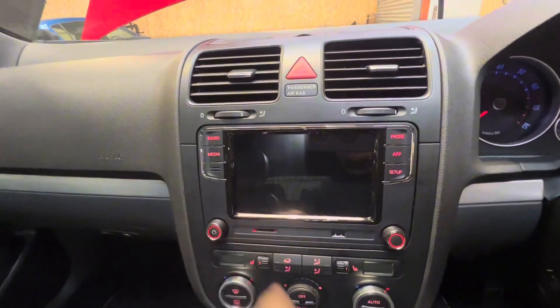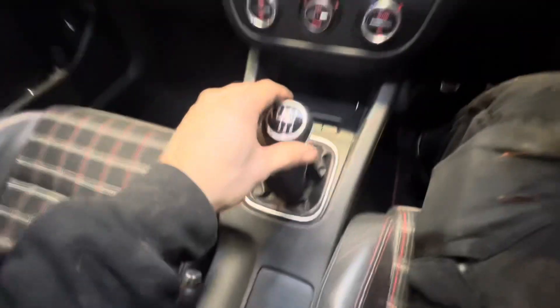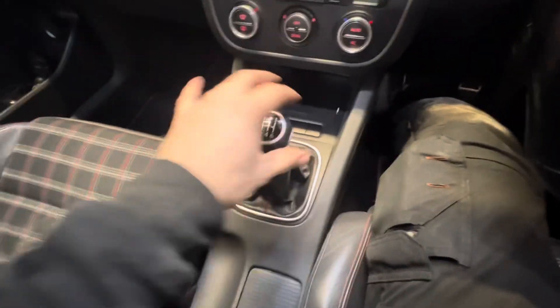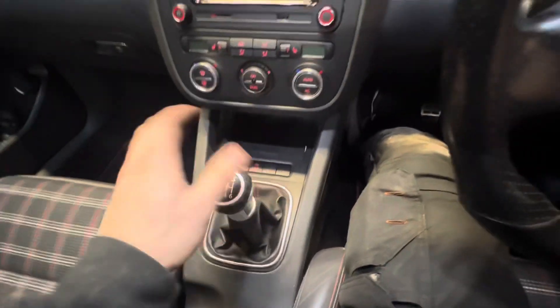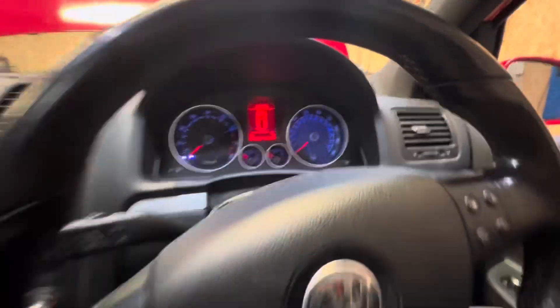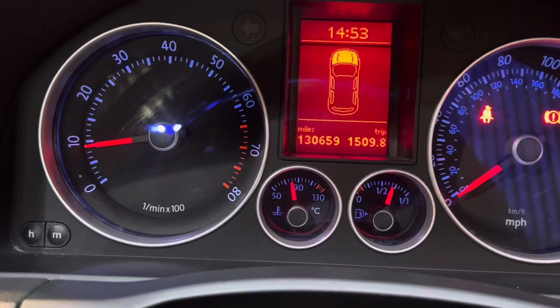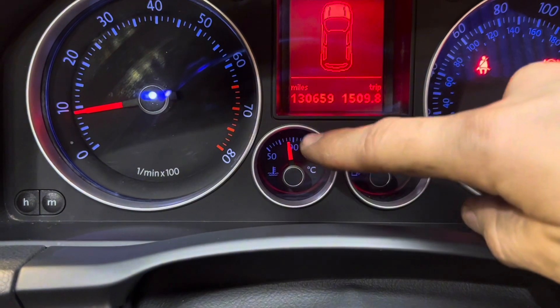A couple of bits inside. It's got a really cool Mark 7-style radio. But the gears are very, very floppy, and putting it into first is a bit - if I just go like that and up, it gets jammed. I have to really push it over. So there's something wrong with the gear linkage. Also it doesn't get up to temperature: it's got 130 on the clock, but if you're sitting still it just about gets up to 90, and once you start driving it goes back down. Thermostat needs doing, which I didn't know when I bought it until I started driving it home.